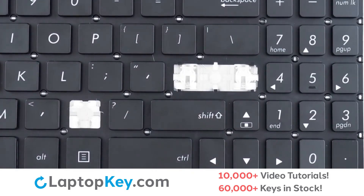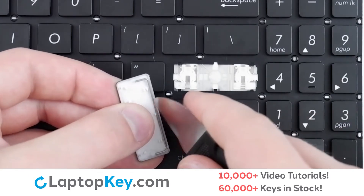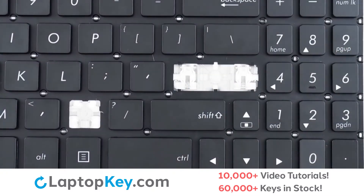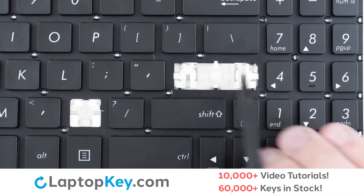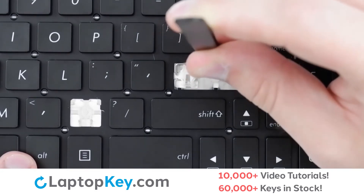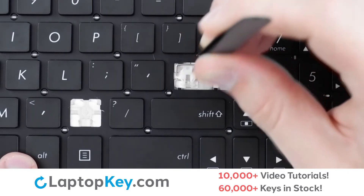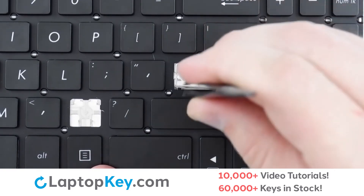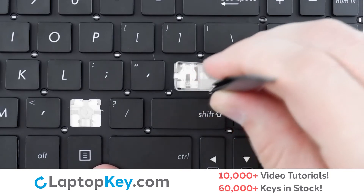Apply a small press at the top and the clip is attached. When removing the keycap, there are two metal arms that may or may not remove themselves. If they don't, to place the keycap back on simply detach from the bottom. Then to replace the metal support arms, there are holes for each respective arm. For the top arm, insert into the top set of holes, making sure they are behind the metal tab supports for the clips, then insert the bottom arm into the bottom set of holes, ensuring it is also outside of any metal support tabs.